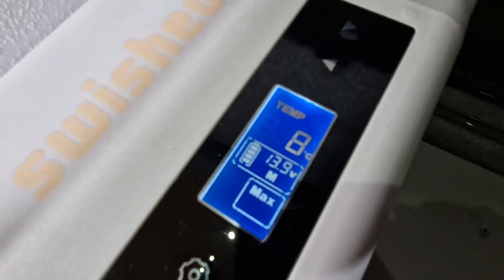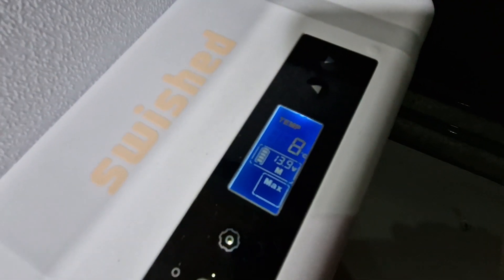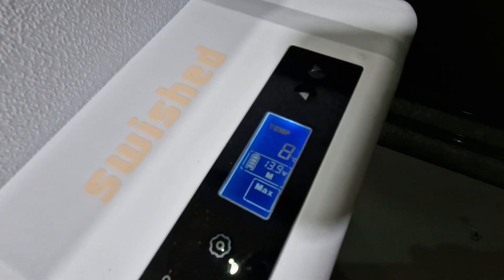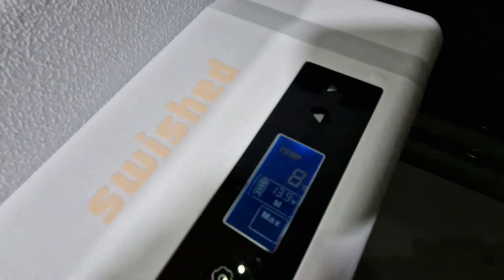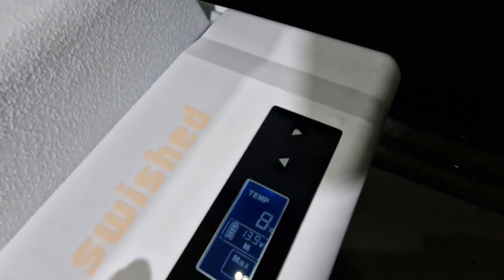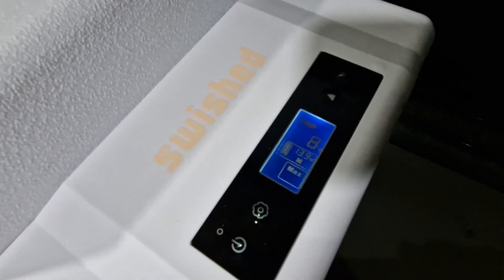So you can see that's receiving 13.9 volts - the internal battery is fully charged. Interestingly, when you disconnect the mains power - and I'll show you in a minute when I do that - that actually changes from 13 to 23 point something, so it's a 24 volt internal battery, but it's charged off 12 volts when you plug it into your campervan, assuming you've got a 12 volt setup. At the top there is the current temperature - it's 8 degrees - the voltage it's receiving is 13.9, and it's set to maximum cooling mode. The settings button only has two options: it's max or it's eco - that's all it is, obviously a power saving function. We'll leave it on max for now, just for testing purposes.